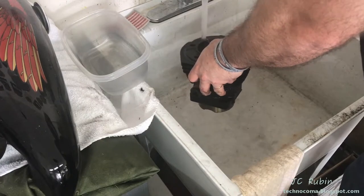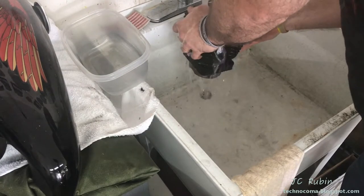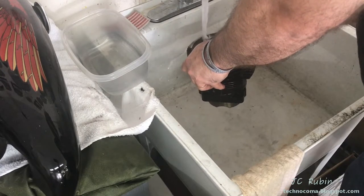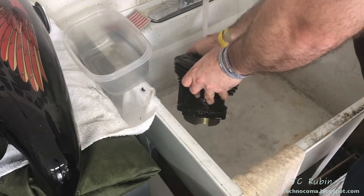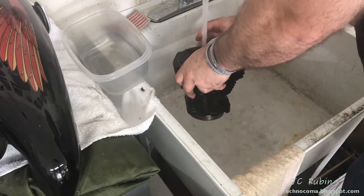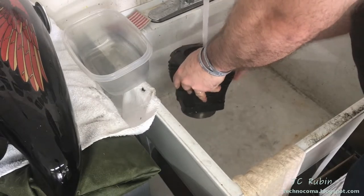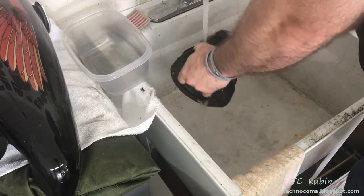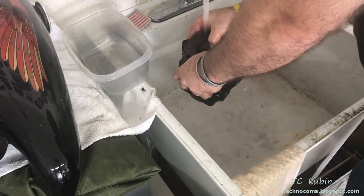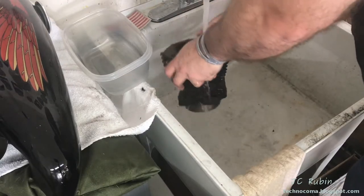Spraying through that oil drain, I could see water pouring through — there's no blockage. It's a rare occasion I get to do this, and already I can see there's some wear on the front and back of the cylinder walls. From an immediate inspection in the sink it doesn't look terrible — I don't see any gouging, just some wearing. Maybe it can be honed out, I don't know yet — it's going to need to be measured.